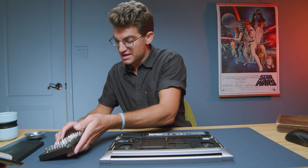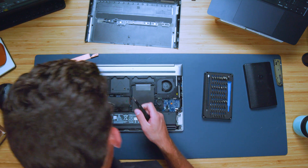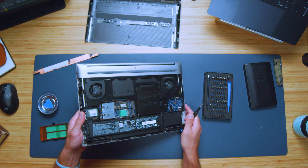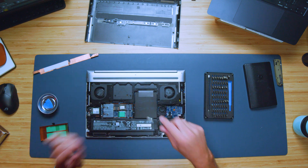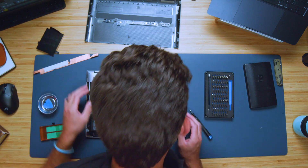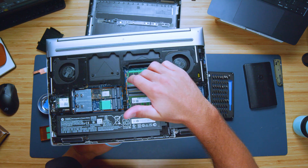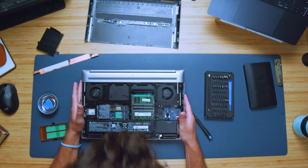That pops out really easily. There's a little heat pad there, and there's a tab you pull to pop it up — and there you go. The model here comes with one RAM slot occupied, and you can see there's a double-decker arrangement on each side: one below, one above, one below, one above. Amazing. The same goes for the SSDs. If you're upgrading this laptop and only have two RAM sticks, you want to do one above and one below — just like how desktop PCs do every other slot. If you're putting all four in, obviously just load it up with four. Fantastic upgrade path on this laptop.